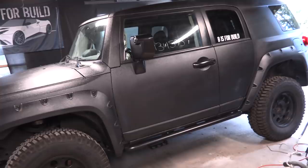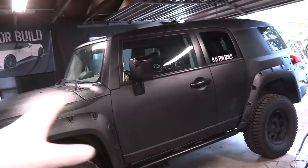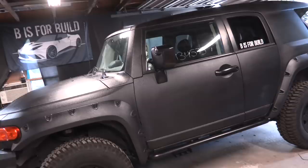My advice if you're doing this at home: just do it outside in bright sunlight, you'll have better lighting so you don't make the same mistake. Luckily we're in what's called a respray window. Most industrial paints have this where you can add paint on top and it will stick. If you were a week later you'd be in trouble. We're going to scuff it up and paint prep it, then paint the back side and the hood.